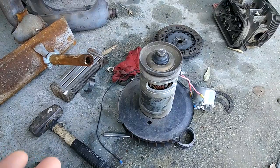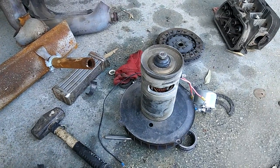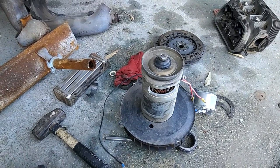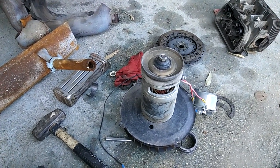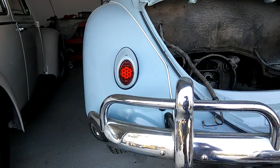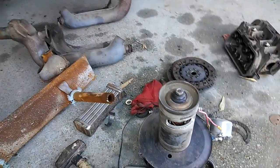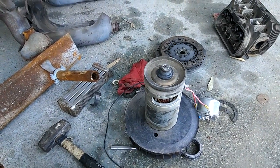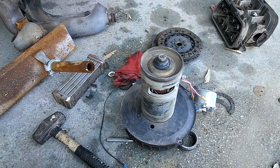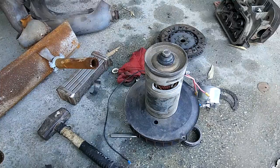Today you can't charge your cell phone on a six-volt system — there are just so many things you really need a 12-volt system for. People say 'I'll run six volt,' but you're risking getting rear-ended driving down the road because people aren't looking for dim tail lights. Especially with one of these old cars, this little tail light being dim is a real problem. It's not very good for your car or for you, given the protection those old cars had, so it's really a smart idea to put 12 volts in your car.